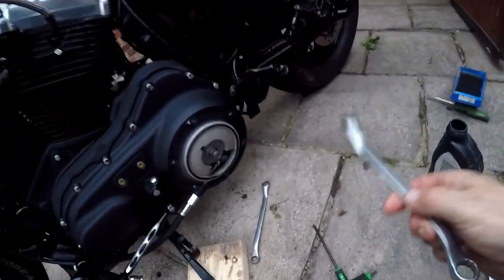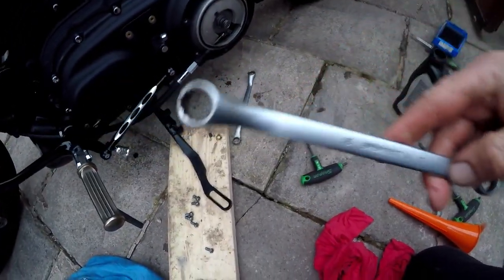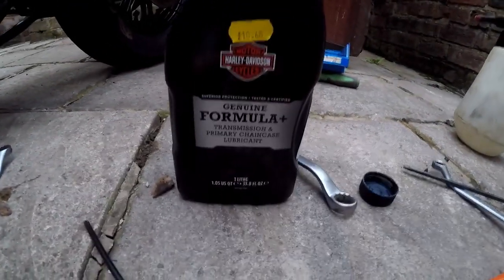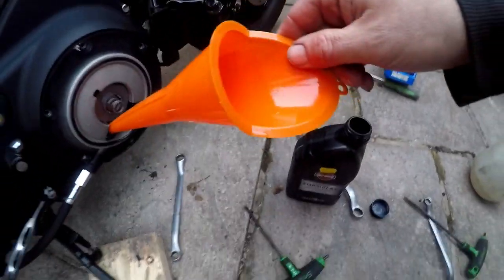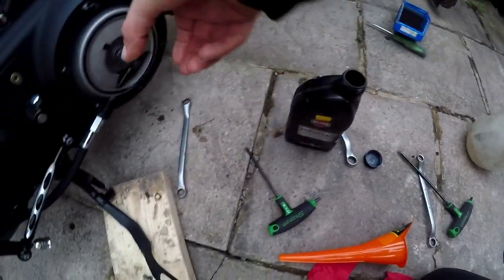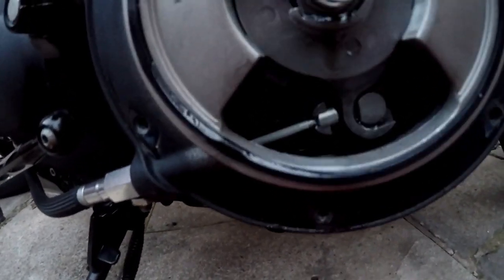Just as a reference — I'm sure I said 17mm for the transmission plug, but I think it was because I was holding a 16-17 wrench. So remember, it's the 16mm side. We're ready to fill her up using genuine formula transmission and primary oil. We'll fill her up through there with this funnel. You can buy funnels with an extendable filler which you can get in there more easily, and for the price these things are handy. We've put the full one quart of primary oil in — she'll take all of that.